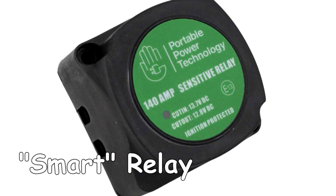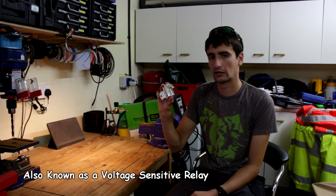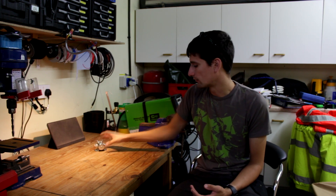The second option is a smart relay. A smart relay is basically the same as a dumb relay but with a little extra circuitry. What it does is sense the voltage of the battery — most likely the starter battery — and once the voltage reaches a specified level, usually set from factory or user-programmable on higher-end units, it activates the relay and joins the two batteries together. It works on a very similar principle to the dumb relay, but the trigger mechanism is slightly different.